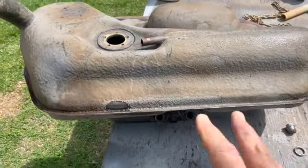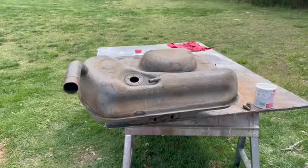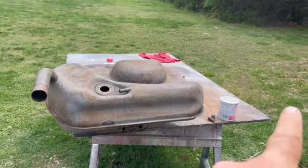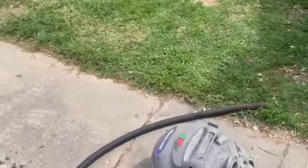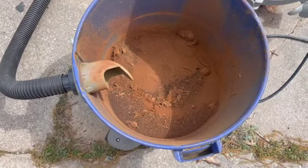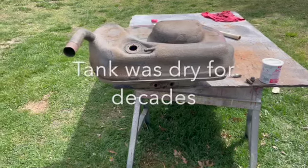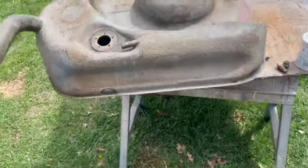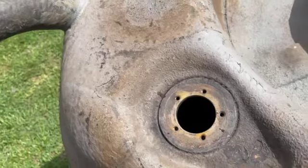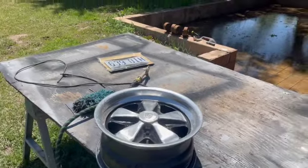I'll give it a few days to dry, vacuum it, use the air hose to help the process along, then put the plugs back in and line it with the red coat. We're going to keep blowing the tank out with the air hose and give it a couple days to dry real good before we put that stuff on. This is probably about half of what we actually got out using the chain — rocking it for what felt like a couple of hours. The chain vacuum cycle, along with the air hose, did the job. Now the sides are clean and shiny, almost galvanized — I wish I had a borescope to show you just how clean and silver it looks in there.